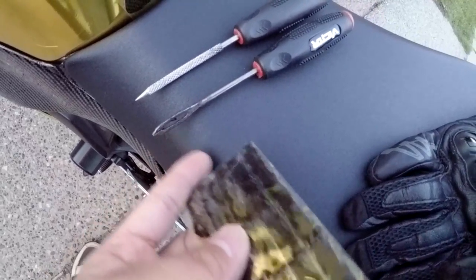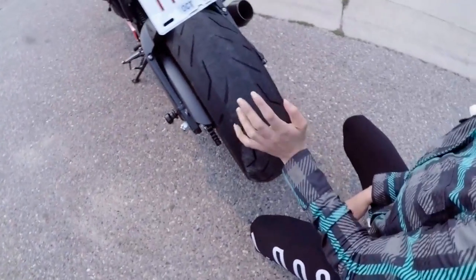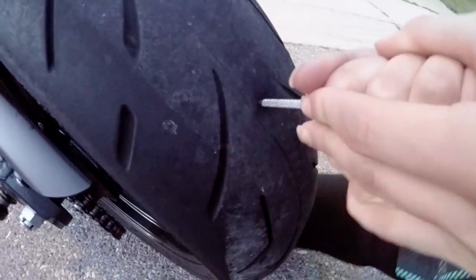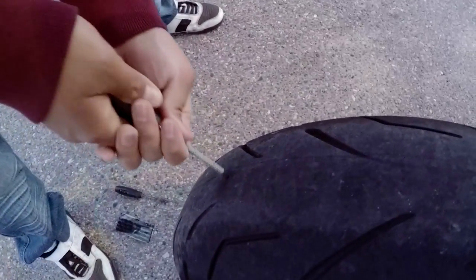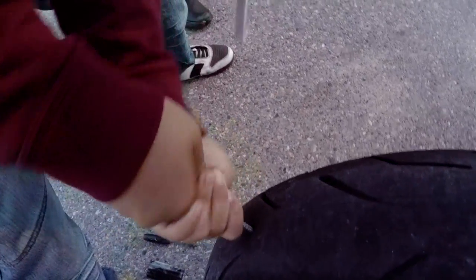Here is the actual tool to get the patch in - this is super gluey, rubbery thing in here. These are the strips. You kind of squeeze them in there and then push it into the hole as tight as you can, and you pull it out and it should be fine. So Alina is gonna shove that thing in there as hard as she can. First put it in gear so it doesn't roll away from you. There's the hole - we can even hear it and see it. I remember this being extremely tough to do. At first it was really hard and then after a while it became easier, but the other part is really hard to put in.